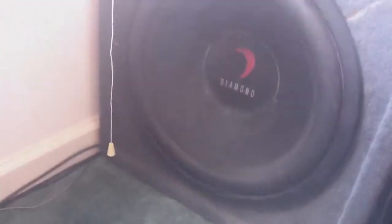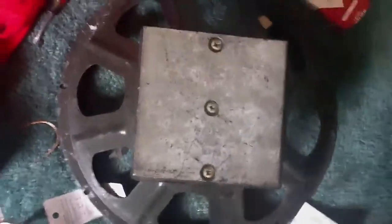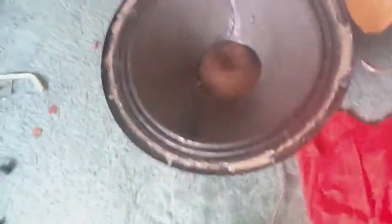I know some car amplifiers cannot run 2 ohms stable on bridged, so that would be kind of helpful. A lot of speakers are like this — a perfect example — these ones don't have any stamped anything on them. They don't say the ohm ratings, and this one actually doesn't either. It's only got some numbers, so there is actually no ohm rating on it.